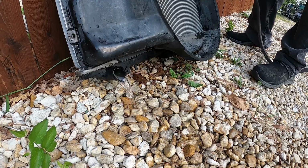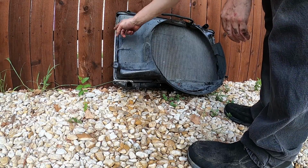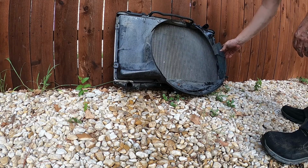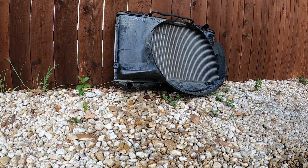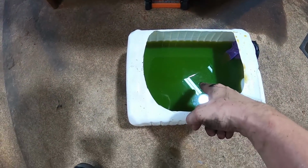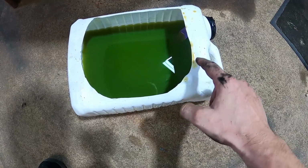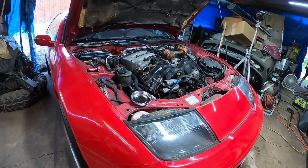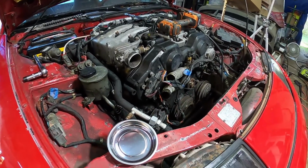Okay. So you're gonna want to cut these off. All four corners, these friggin' baling wire. You're gonna pull this off. We gotta wash it and clean it, and then you want to clean your radiator. Okay. He's cleaning the radiator. I want to show you the fluid. Now it looks green, right? But that should be a lighter color green. So when you look over here, see how it's got all that rust and nastiness in there? We're probably gonna run the hose in here and flush this engine out.